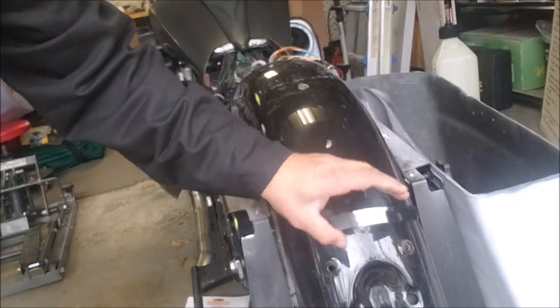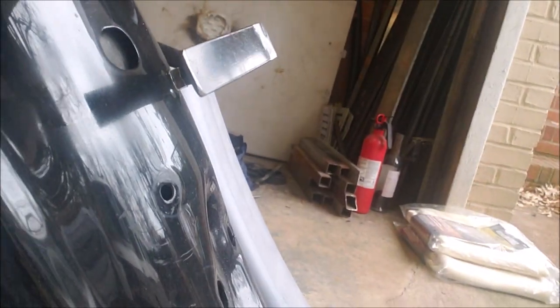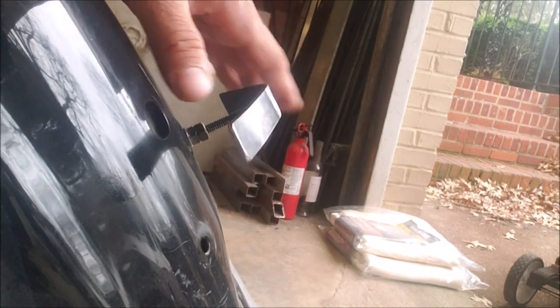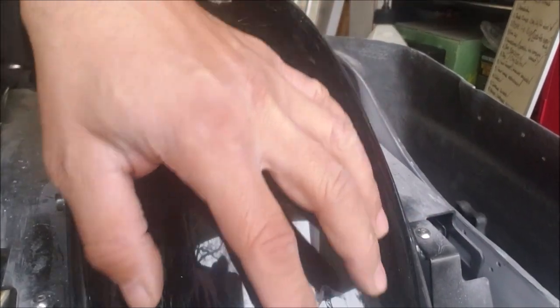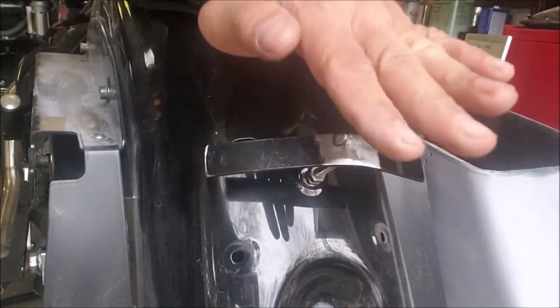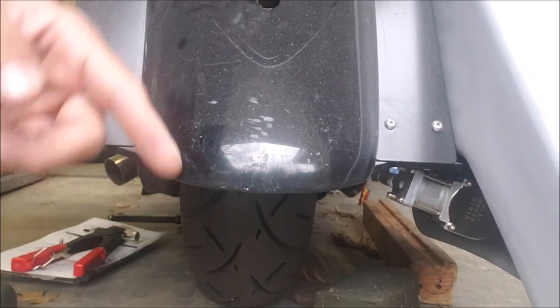This is roughly where the fender sits away from the OEM fender, so this will be the support there. In this hole here I'm going to put a standoff and attach the fender — this gives me rigidity by locking it down. This is just going to be support off the OEM for the aftermarket fender, keeping it pulled away from the bottom. I might also come from the bottom and bring something up to tie into behind where the license plate comes through, just for extra support.